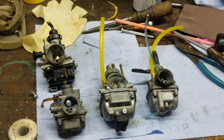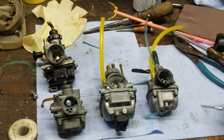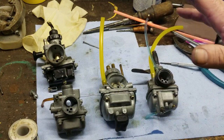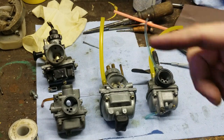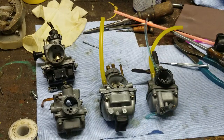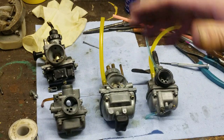And if there's a little bit of white corrosion in there, it's not going to kill you. Okay, it's stained into the metal. I scraped it out with the edge of a screwdriver. Get out as much as you can, and then it's as clean as it's going to go. If it's a little bit of tinged white, don't freak out. It's not the end of the world. I can't get this out with my ultrasonic cleaner. I put it in the dip and it's still doing it. I took sandpaper to it. Guys, it's just into the metal. That's all it is. Scrape out all the heavy, clean it, done. You can use carburetor cleaner. You can use WD-40. You can use anything you want.